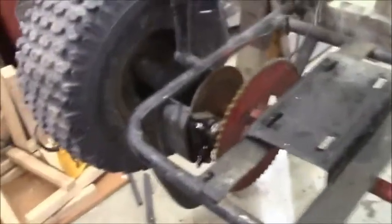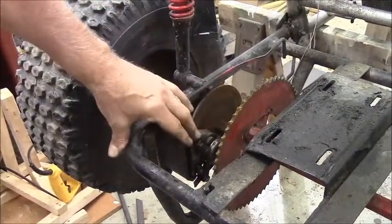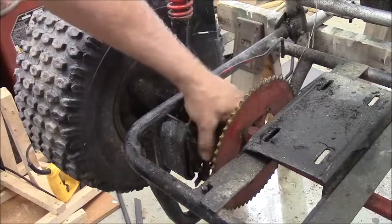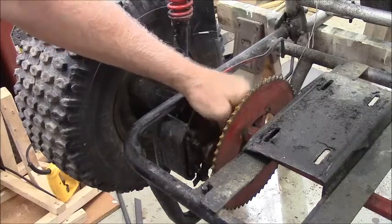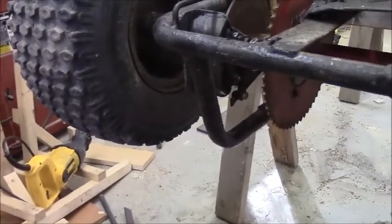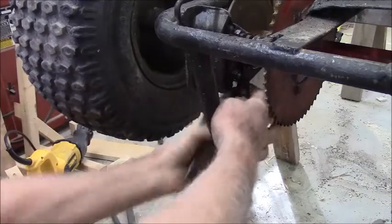At Go Power Sports you get the flange, the brake disc, the bracket, and the brake assembly. This one's probably shot, but the disc is fine and the bracket is fine. It's a self-adjusting bracket — you can see the caliper is kind of loose in there and can slide on these tracks. I've got to figure out some way of getting that nut off the quarter-inch bolt, because the bolt was bent and broken off.